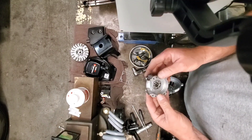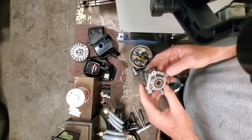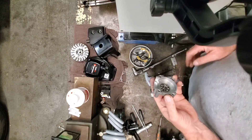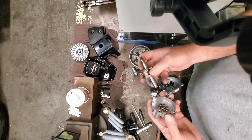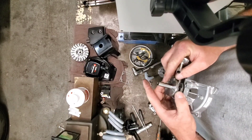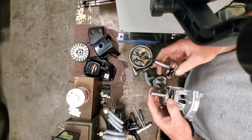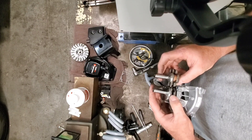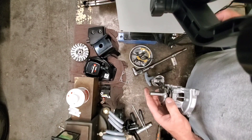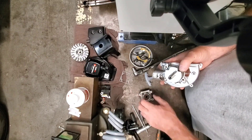Here's what's inside one of these guys. As you saw, there's a nice bearing in here — these things come stock with a sealed outer bearing. I'm a fan of having the double bearing on these. On the modified motors they're using the Chin Yang crank, but the difference is our Zenoah crank is nice and straight all the way out, so you can have these double bearings, it seals up pretty good, and you don't have a crankcase leak. The Chin Yang actually has a bit of a taper to it that you can't really see without measuring it.